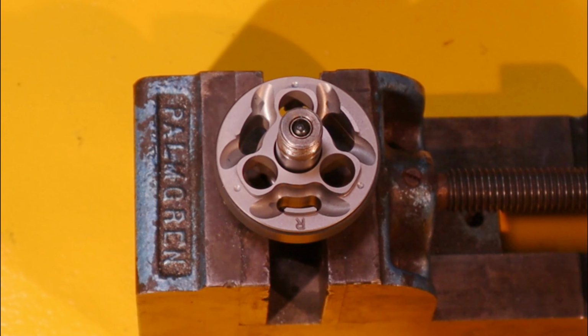This is their so-called high-flow piston. Now, this wasn't for any weird application. It was a road race application. I put their linear piston back in, and that was that. So I don't know why they would put this high-flow piston in anything. Probably it makes some sort of digressive damping. Maybe there's a reason for it. I don't know. But we're looking at the rebound side.